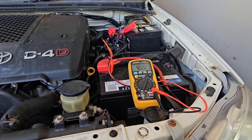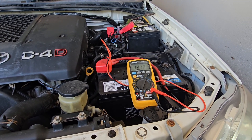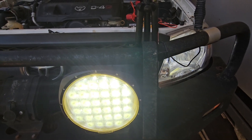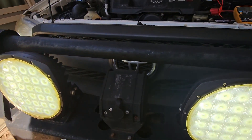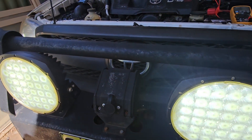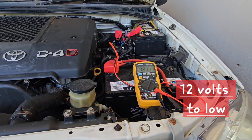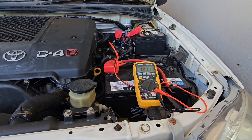We can see the voltage actually going down as the lights are on. The voltage is actually dropping — it's falling down, it's almost at 12 volts. If we drove for any period of time that voltage would get to the point where the engine would cut out. So we've definitely got a problem there. Let's do some further checks on the alternator.